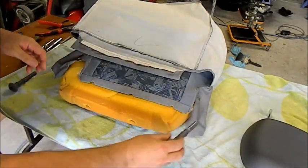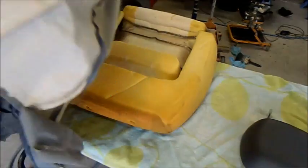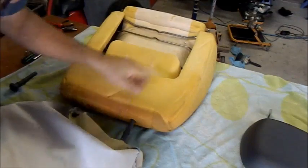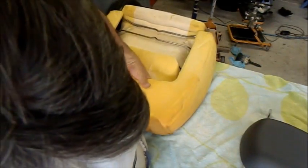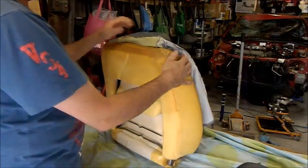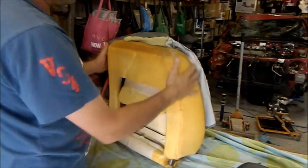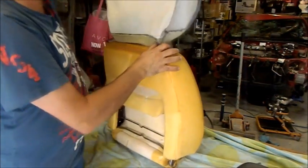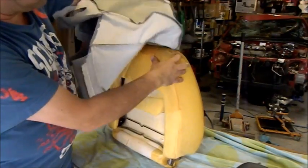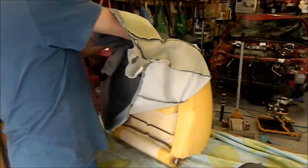And so we're going to use this one to locate through the seat on top here. Now, I've got to find the hole. Where's the hole? Here it is. Just like that. Now a good trimming trick is to put Glad wrap over the top of the seat, and that lets the material slide down over the squab nice and easily. I'm going to try and do it without it and just sort of unroll it down, but I can only unroll it a little way because I've got to do that listing in the front.